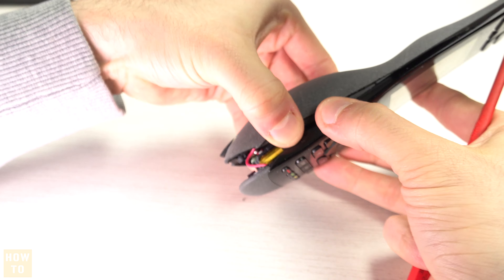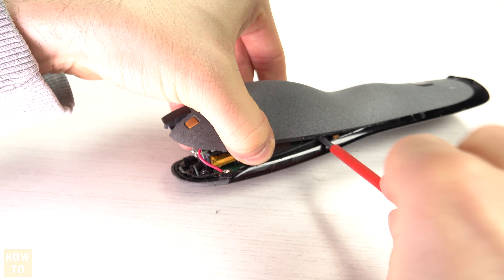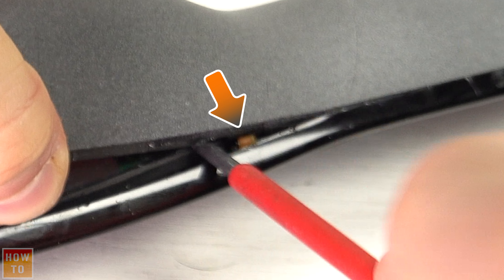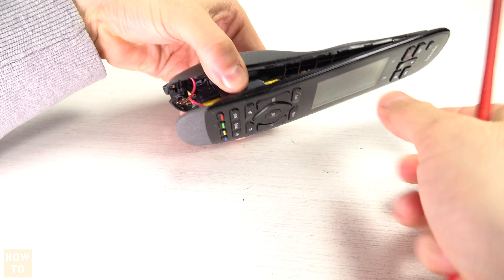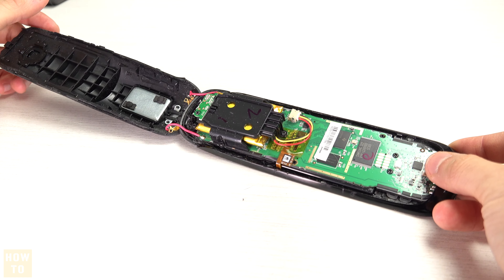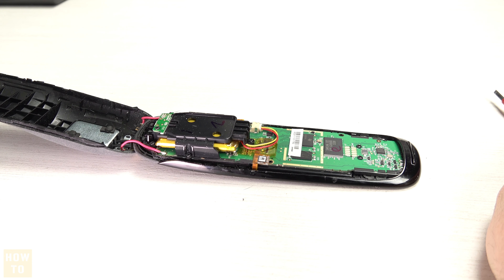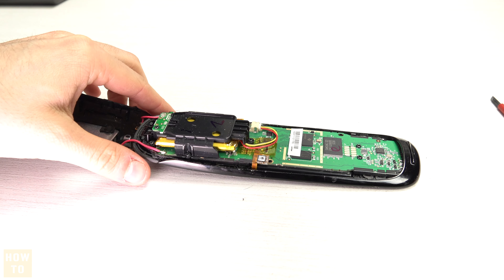But on the other side there is a complication. Right here, I broke my remote because of a cable that connects the touch panel to the processor inside the remote. I cut this cable with my lever. Be very careful on this side — my remote is still functioning but the touch control no longer works, and you need touch control to start an activity, so my remote is not good anymore.